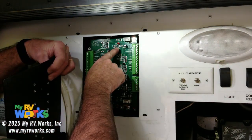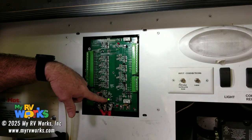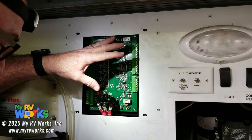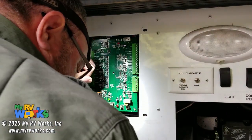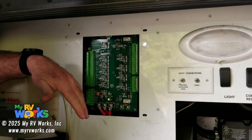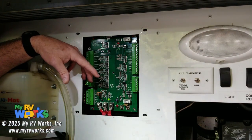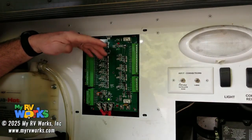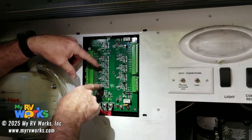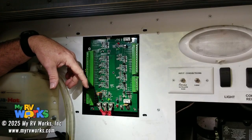If the switch is on, if somebody turned a switch on, that light turns on. So a lot of times you can tell the difference between this switch being on and this status light down here. If your Aquahot is at temperature and everybody's happy — the Aquahot takes about 15 minutes, plus or minus, depending on ambient temperature — to go from ambient, which right now is about 65 degrees or so, up to 180 degrees. When it gets to 180 degrees, the Aquahot will turn off, but your status light will stay on, meaning 'I am satisfied, but I will start back up again if I need to.' Then you start turning on your different zone heats. These will turn green based off of the zone. The next video we're going to be firing this thing up and seeing it, starting with the zones, and we expect the pumps to turn on.